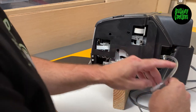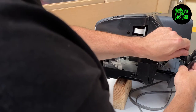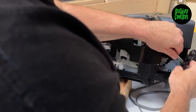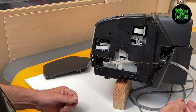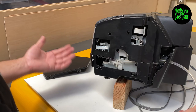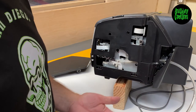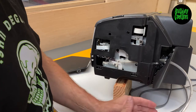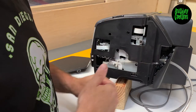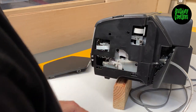Once you put that in, you could either leave this back cover off, or what I did was drill a hole in the back so I can still leave the cover on — just because there's a lot of dust here. Once you have that done and you have your piece of tube hanging out, I suggest you have at least two or three feet of tubing so when you have this on your desk, it runs down to the floor into a soda bottle or water bottle. I've seen guys put trays right next to it — a small Tupperware works — but I'm clumsy and I'll knock that over and there'll be ink everywhere. Get a bottle — that's what I suggest.